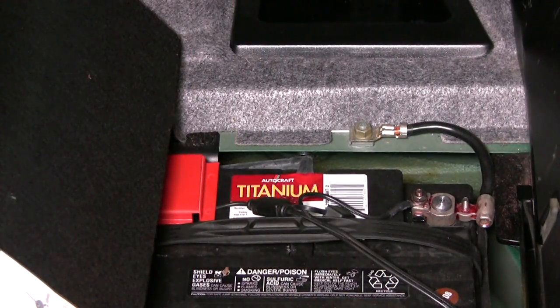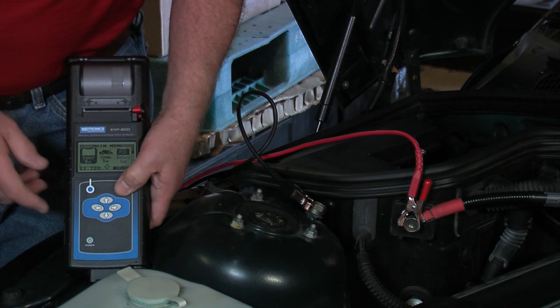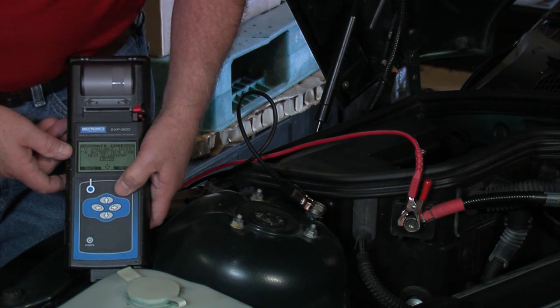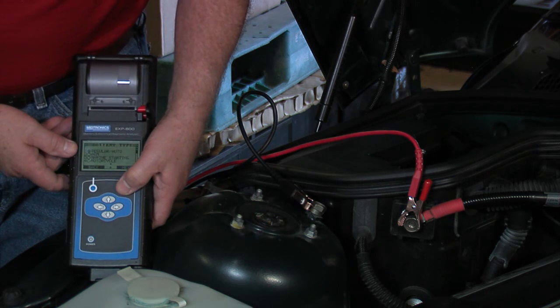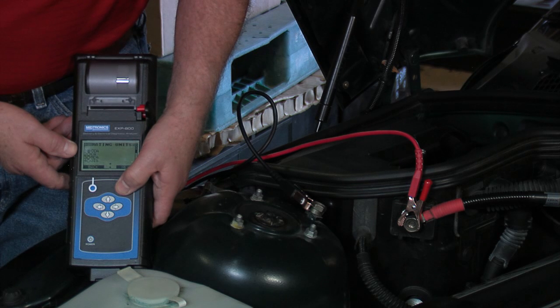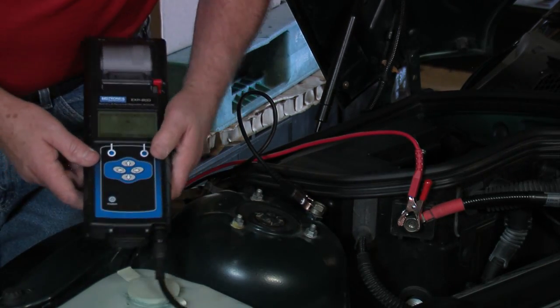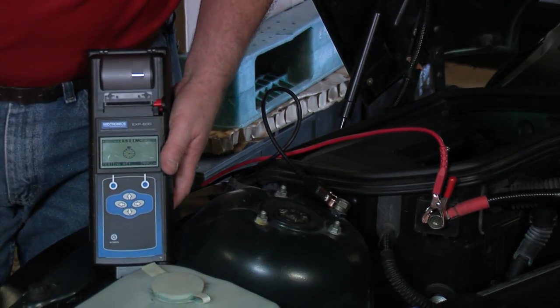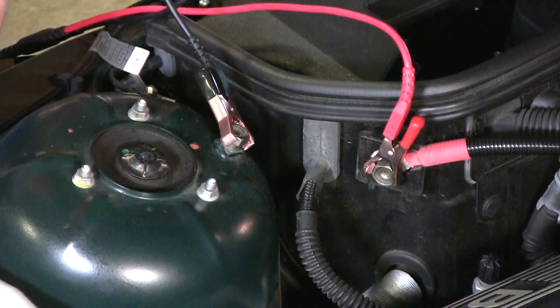I've already looked at the battery in the trunk and it's a 700 CCA battery. We're going to test in English. In this case we're not going to do the full system test — we're just going to worry about the battery test from this location. No warranty involved, so we'll move past that. We are in vehicle, on the jumper posts. It is a standard flooded battery, automotive style, rated in CCAs at 700. It's asking for temperature — I'll just take an ambient measurement because that's the best we've got. The tool is attempting to test, but we get a message: there's system noise. What can happen in these cases — we don't know what the resistance of the chassis is or what the resistance of the cable going back to the positive terminal might be. So this does provide a step-down function where it's going to try to give you some kind of reliable result. But ideally, you're always going to go to the battery terminals.